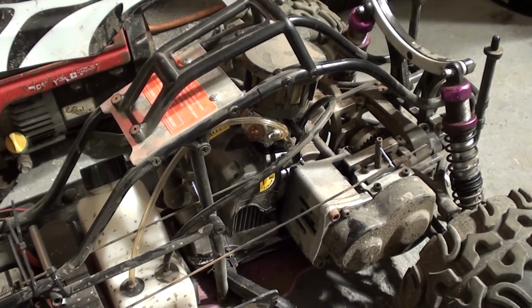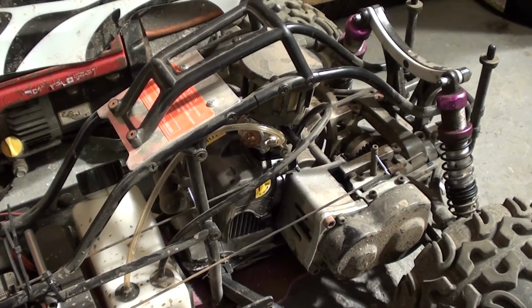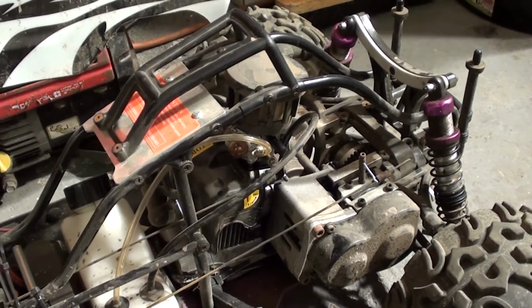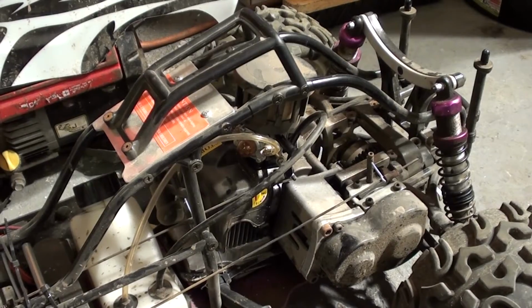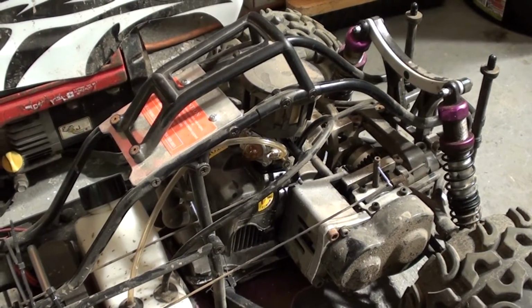But with a carburetor, you have to do it yourself, and the colder weather is denser, so it will need a little bit more fuel. So you've got to make sure it's not running lean. And you'll know if it's running lean because when you go to rev it, it will just die. And if you keep blipping the throttle, it will gradually pick up and go.